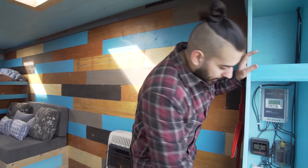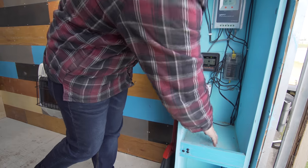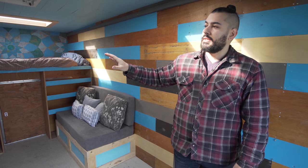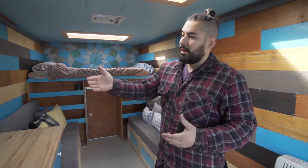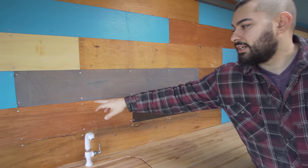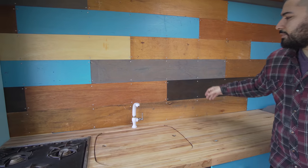I had a 1500-watt inverter that I've since taken out — it just sat plugged in here. Insulation is two-inch rigid foam insulation cut into battens and fitted between the structural ribbing that runs through the whole box, with the same approach used on the ceiling as well.